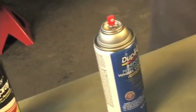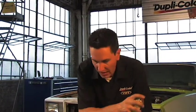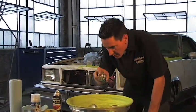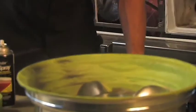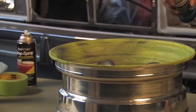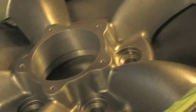I have this all wiped down with the prep spray and now it's time for paint. Whenever painting a small confined area like this, you really don't need a whole lot of long sweeping motions. You're just going to want to lightly spot it here and there — just dust it on. Make sure you're still putting it on nice and even because you don't want any runs. There's a lot of little hard to reach area, so we have the conical valve on here. You don't want a real heavy first coat, mainly because you want something for the second and third coats to bond to. Just lightly cover it and then go over that with the second and third coats.